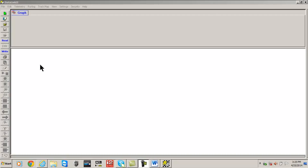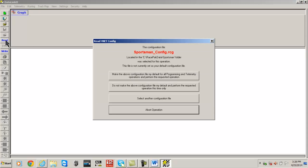Here are the steps for how to change the configuration file to recognize any sensors you add. In this example, we will update a Sportsman data logger with an oil pressure sensor. To sync your Race Pack configuration file with your data logger or digital instrumentation, open the DataLink2 software and select the Read icon on the left-hand side of the screen, or select Edit and Read from the main menu. The window now in view presents the option of selecting one configuration file as the default for use with all downloads and telemetry actions.